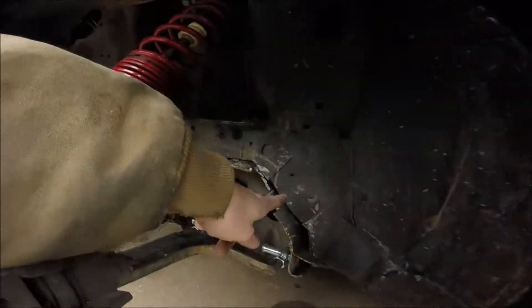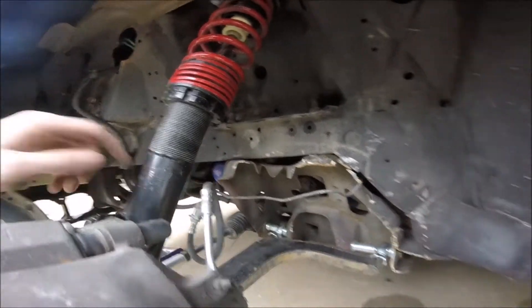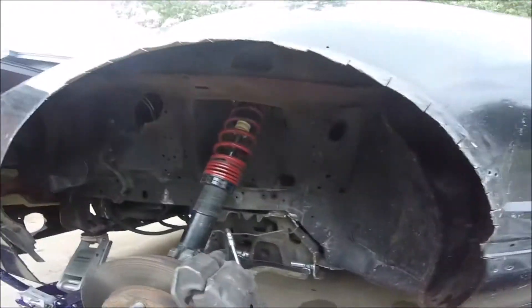Well, bummer. Here's the part I cut out for the wheel to come through — I cut it off, but I'm going to cut the rest of that off too. I need my brake line just hanging around in there. All righty, well, that's a bummer. I'll take it apart and take the ball joint out and tack weld it back in later.